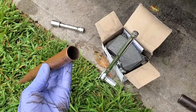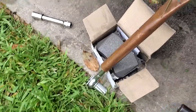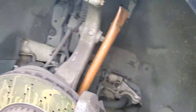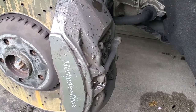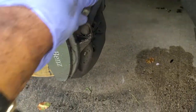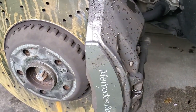One tip I want to make: you want to have something to give you leverage — we're going to put this over, and sometimes your bolt is hard to get off, that's why we have stuff like this, it'll actually give you leverage. So now you have leverage to actually pull that bolt down and take it out. Now that both bolts are loose, we want to take a tool like this and a hammer and bang this pin out — we want to push it so it actually sticks out over there. Do the same thing for this one as well, and then we're going to take the caliper off and we'll be exposed to the brake pad.